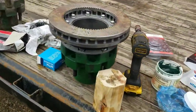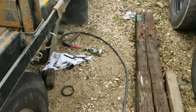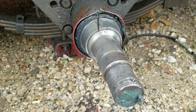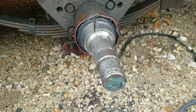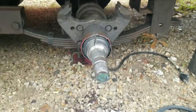I got everything all built up and ready to go. I got the new rotor, the new spindle in, new bearing. The problem that we're running into now is the bearing has welded itself to the actual spindle. That is some bad news. In that case, there's one of two options you can do: either you can cut that spindle off and have someone weld a new one back on, or you can replace the whole axle. I'm not really sure which one's cheaper or more expensive, but that's what is going on with this.